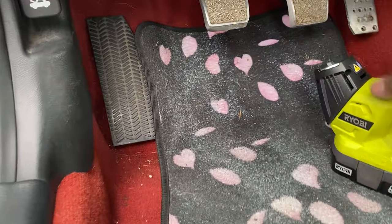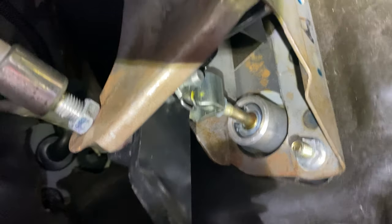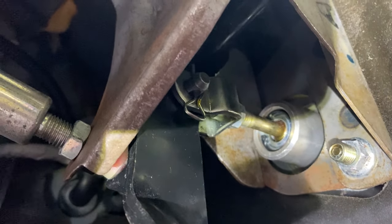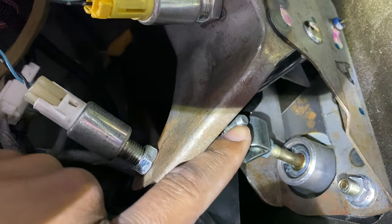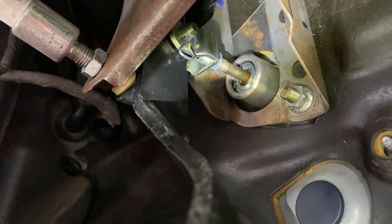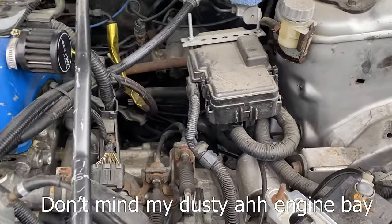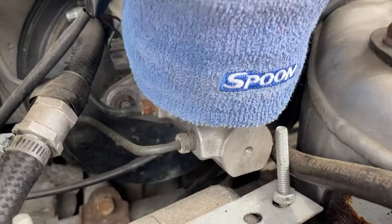The first thing I'm going to do is come down here and start removing the car-side of the clutch. You have that pin right there that you want to take out, then you remove the rod, then those two bolts, and then we'll move under the hood.